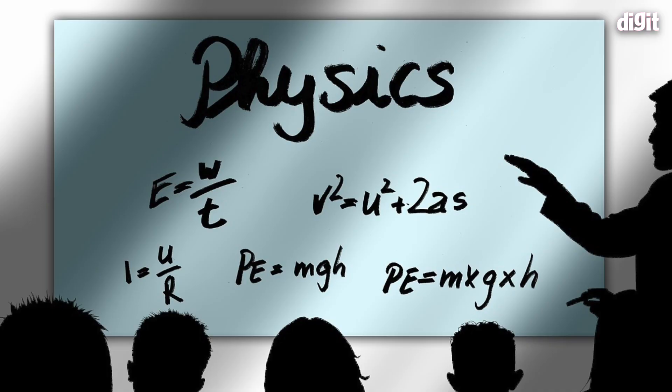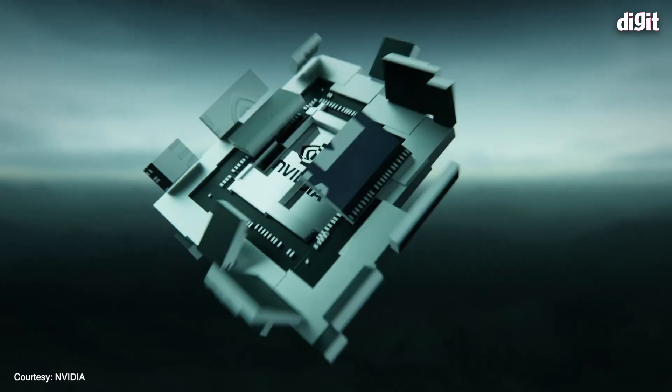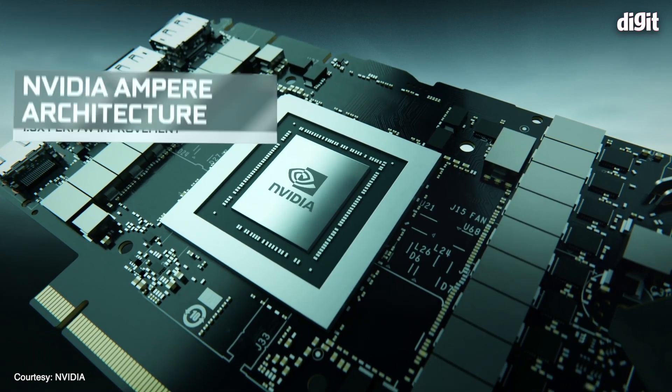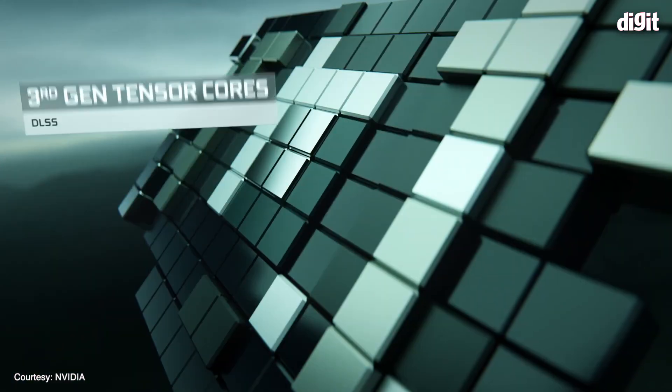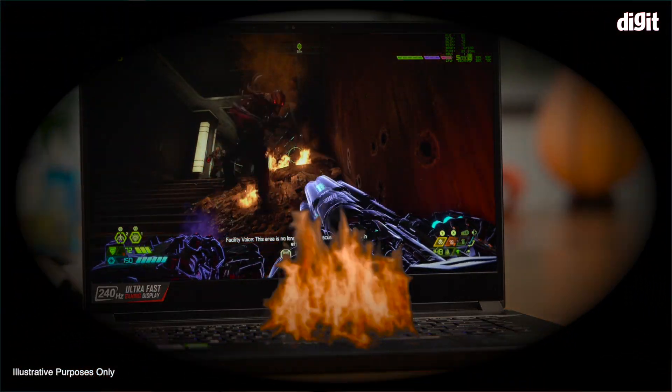That's not necessarily a bad thing, because laptop GPUs and OEMs must work within the laws of physics — heat and power. A desktop GPU can draw as much as 300 to 350 watts in the 30 series; you can't have a laptop drawing that much power and still be this thin, and you can't dissipate 300 watts of heat in a machine like this. Given that the 30 series improves its manufacturing process to 8 nanometer, you've got more powerful cores on board. The reduction in cores is probably the only way for NVIDIA to make these GPUs laptop-viable — if they still had that many CUDA cores, you'd likely see very serious thermal problems.